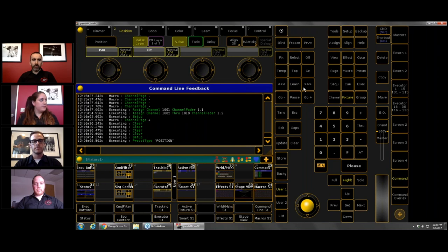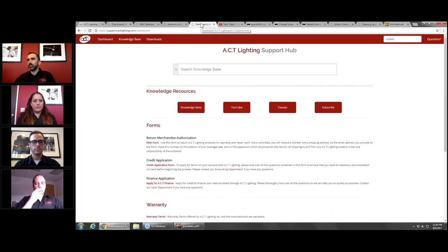There was just a list of stuff: boot failures, screen issues, crashes due to hardware, ambient temperatures. I showed that, that's the quick start guide. Boot failures: do a factory reset. I showed you that screen here on the dashboard, where... I lost the tab, sorry, but you do the factory reset of the software, download a fresh copy of the software, maybe you have a bad download, use StickMaker to make a stick again. I've actually seen this: you're reading about a gig worth of data from the USB stick every time you install software on a console. Guess what, USB sticks are cheap, they don't have very good hardware.